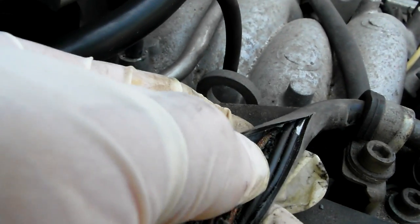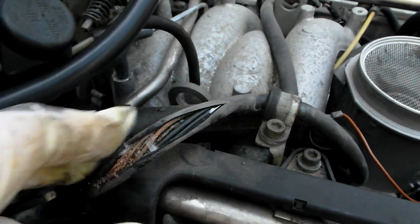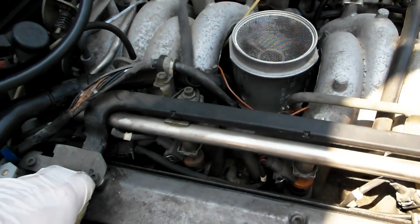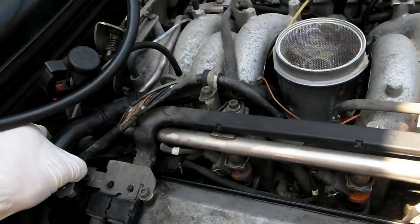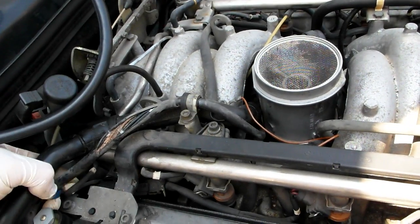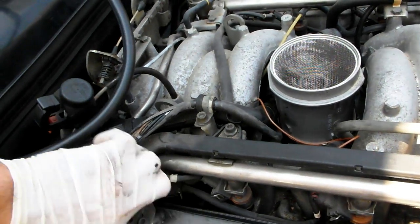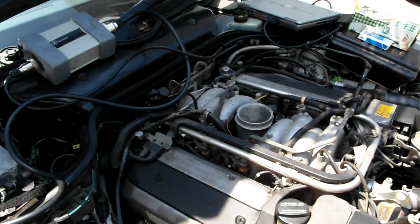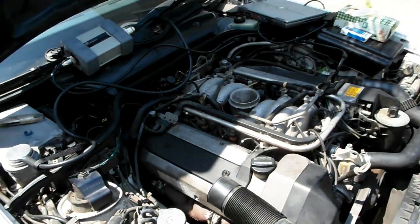From the beginning to the end of the throttle body cable, these wires have no insulation — it's just dust. They're all touching and all shorting. So before anything else is done to this car, the throttle body must be removed and repaired. Once it's repaired, check for codes and follow the normal procedure, which I'll cover later. In the next set of videos I'll show how to remove throttle bodies — hopefully it will help others fight these ASR problems. To remove the throttle body, you'll want to remove the air cleaner and the cover on the passenger side so you can unplug it. Stay tuned for part two.